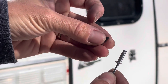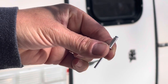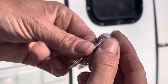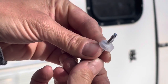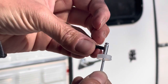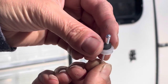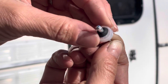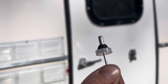Take your rivet and — I forgot one step — you're also going to want a plastic washer like this. Put your rivet through a plastic washer, which you can buy from the Scamp website. Then put a little butyl tape around it and squish it on there. This is going to help you get a waterproof seal when you put this through your fiberglass.